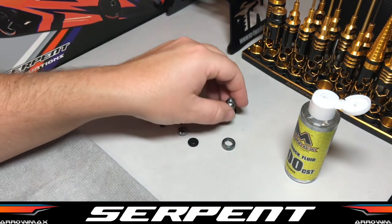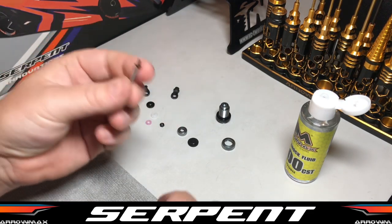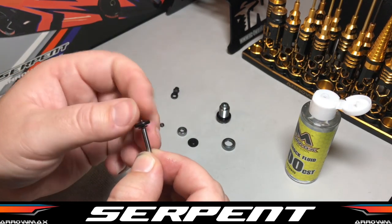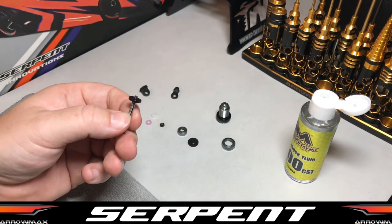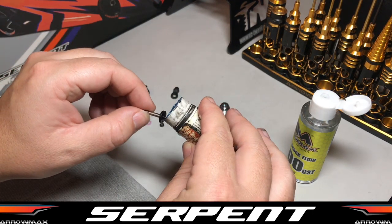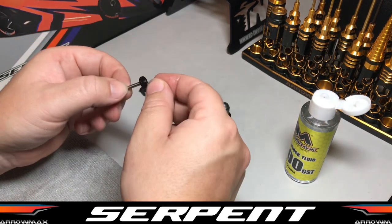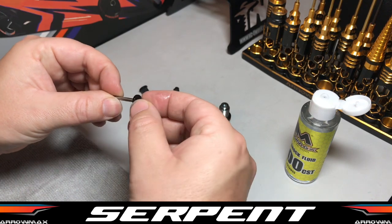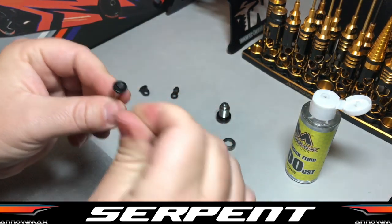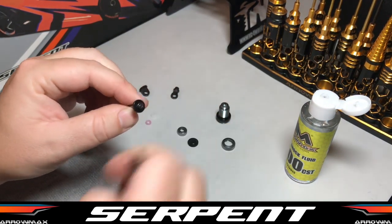Alright, next we're going to put the piston on the shaft. I've got our shaft here with the built-in washer, again new for the 989. The piston can go either way, no problem. This is where I like to use a little dab of Loctite on the thread here. Again, using the paste makes it pretty easy. Put our nut on top there. Then our 5.5mm wrench, nip it up.